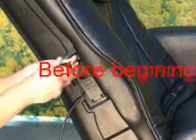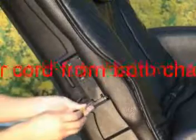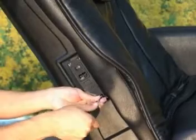Now we will show you how to loosen the power switch box. You locate these four screws, and you need a Phillips screwdriver, and you unfasten them, like so.